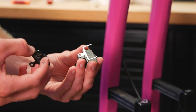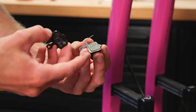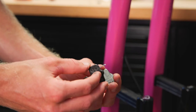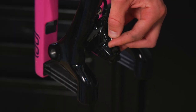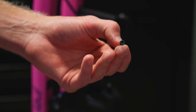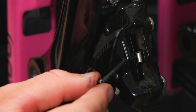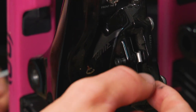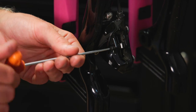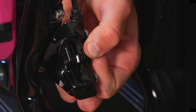After everything's cleaned up we're going to pop the pads back in. I find it easiest to put the spring on the pads first and make sure the legs of the spring are down either side of the pad material, otherwise you'll get that annoying ticking noise. Then pop it back into the caliper. We're going to grease the pin threads just under the head, otherwise they have a tendency to seize — and they've only got a small hex head so you can easily round them off. Pop it back in, make sure it goes through all the holes including through the spring, nip it up, and don't forget the retaining clip on the back — important so the pin doesn't come out.